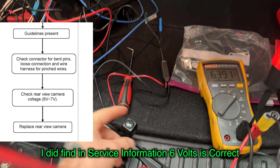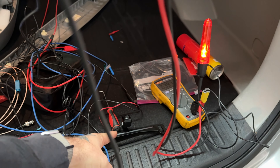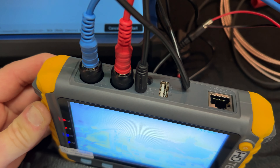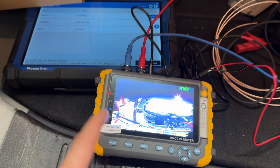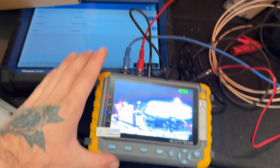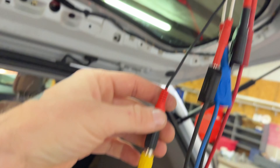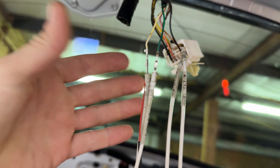I finally got a picture. Apparently this camera in the liftgate runs on six volts, and that's not enough to power my little aftermarket camera. So I've got it in a spaghetti nest here — this camera is getting 12 volts from the tester, and I've got my input just tapped in with the aftermarket camera wires kind of stuck down in the connectors. I know it's hacky, but sometimes you just got to make things work.